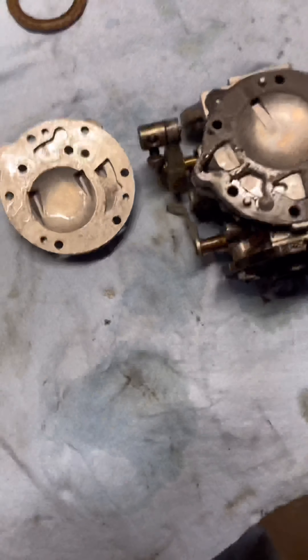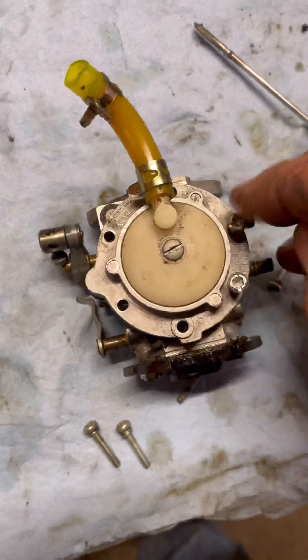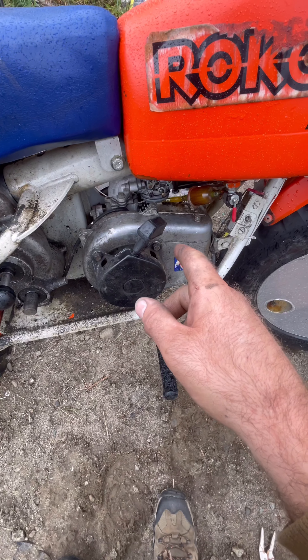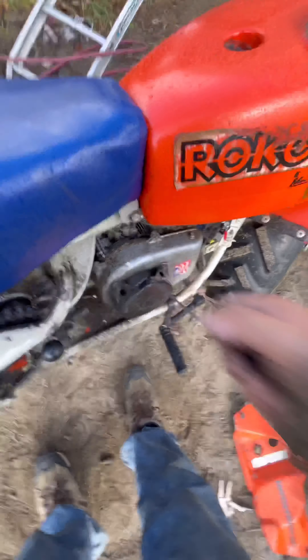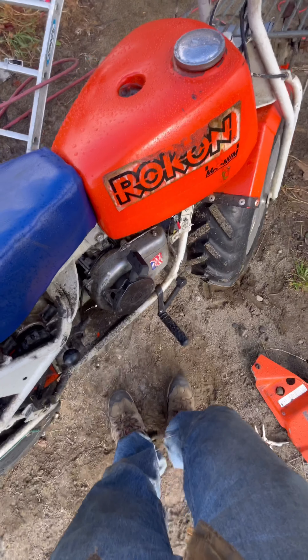The old Rokon does have a couple of problems. It probably just needs a carburetor cleaning because gas is leaking into the engine. You have to shut the gas off — even if it's running and idling, it'll flood itself out and die. You've got to keep on the throttle or shut the gas off. The other problem is the three-speed transmission: all the way pushed in is third, pull out a little for neutral, then second, neutral, and first all the way out. Going up a steep incline you want first gear, but first gear can pop out into neutral and you're heading back down. Good thing the brakes work. I'm going to give it a quick carburetor clean and get that gas issue straightened out.